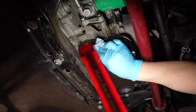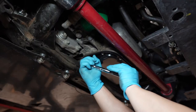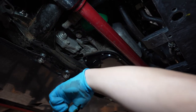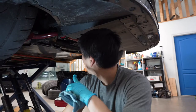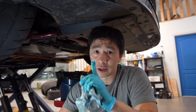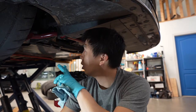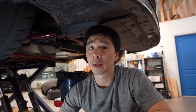Once I take the bolt off — which is a 14mm — we're just gonna drain the oil out. While the oil is draining, a good habit I have is to go around and double check all the torque specs. I know it's a daunting task but it'll save you a lot of headaches. In my previous vlogs you guys may have noticed I did all the bushings and control arms, so right now I'll go around and double check all the torque specs. I have a lot of downtime while the car's on the hoist, so I'll make sure everything's torqued down properly.